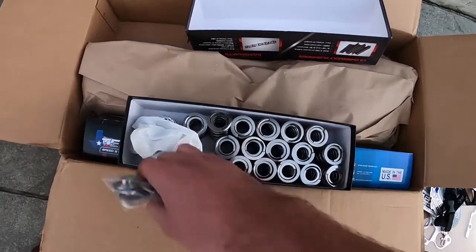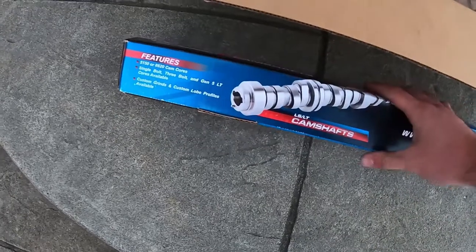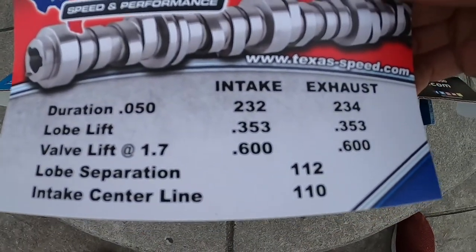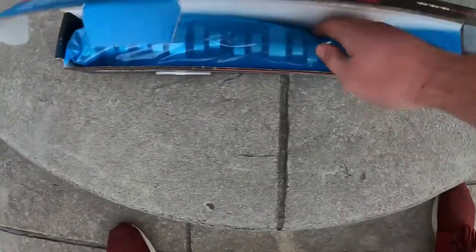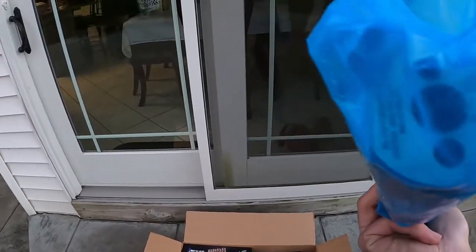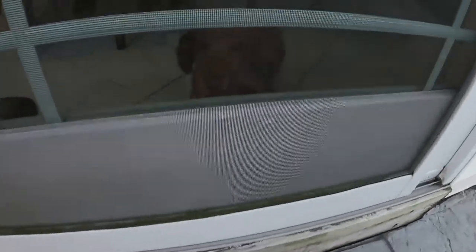And then we have the most important piece to the puzzle — it's the Torquer V2 camshaft. I'll get the little cam card — so that's the specs of the Torquer V2. I went with the 112 LSA, and the 114 I think was the other option, just for a little more chop. And then we got our camshaft right here. I'm going to wait until it's ready to go in to crack it open out of the bag, even though there's a little hole in the bag — it probably has some kind of lubrication on it to protect it. But there she is — you can kind of see the stamping on there on the end of it.